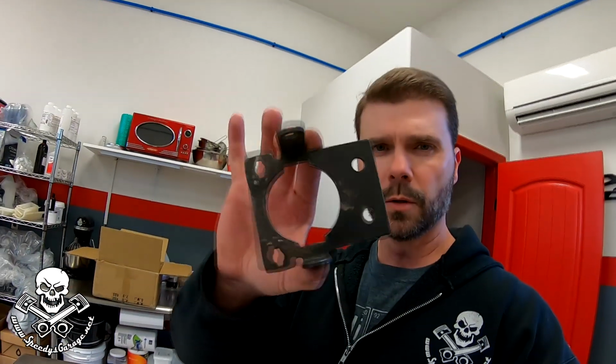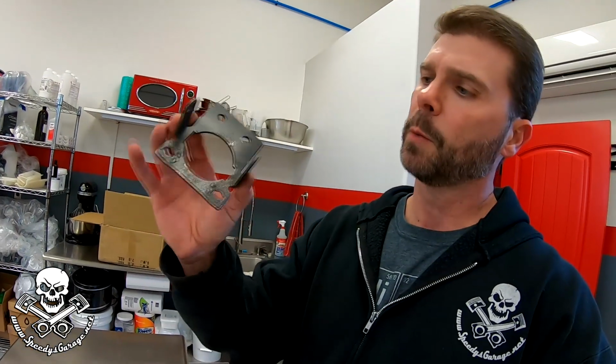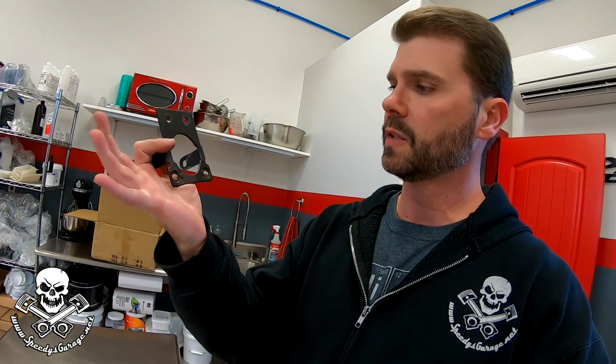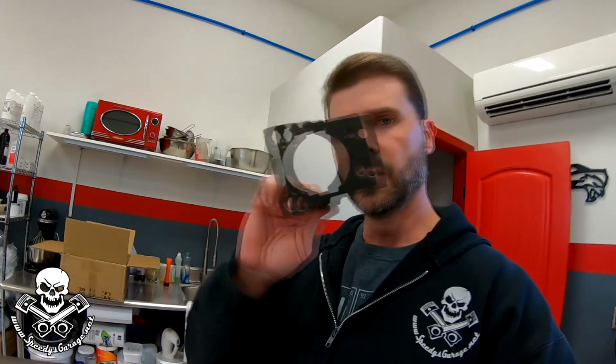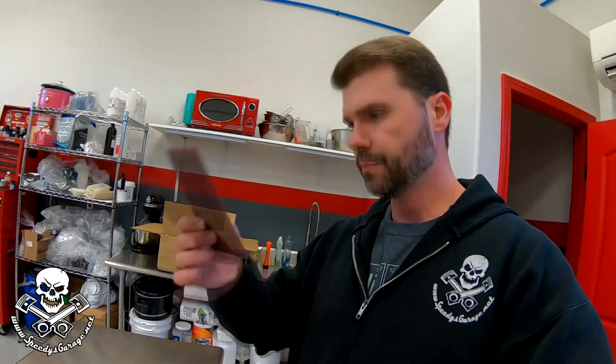So after the wire wheel, that's where we ended up. Purpose of that is to get any loose flakes of paint removed. And you can see it was starting to pit one of these brackets. The other one, not too bad. For some reason it was attacking this other one. I believe these are powder coated originally, and maybe it just wasn't as good or water got underneath that paint. So now I'm gonna go after it a little bit with one of these Scotch-Brite sanding pads just to give it some tooth and to get any other little loose pieces of paint off. Then we'll start hitting them with some primer and paint. That should be good as new.